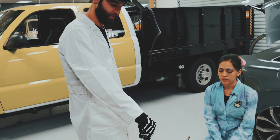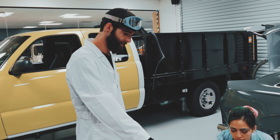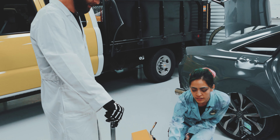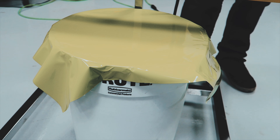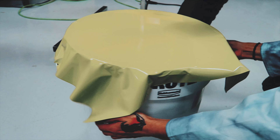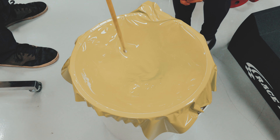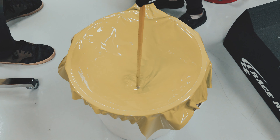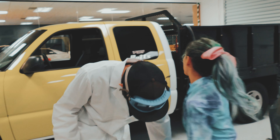We'll heat this first for about 10 to 15 seconds so it's an even amount of heat on each material. Pop an air channel up so we don't cause a huge air bubble. Make sure we're good — set. Go! Looks like we're about 10 inches exactly. So we're gonna put that on the board and re-rebound this material to see how well it actually comes back to its natural state.